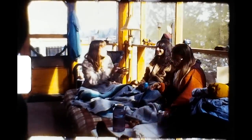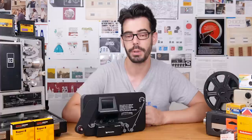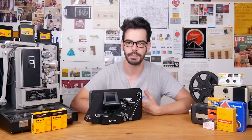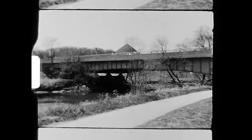It has a resolution of 1440x1080 if you're scanning with the Pro version and has a frame rate of 20 frames per second. Most Super 8 film is shot at a standard frame rate of 18 frames per second and regular 8mm is a standard frame rate of 16 frames per second. But the Wolverine gives you a video file that is 20 frames per second, which is odd. You probably won't notice much of a speed issue on playback, but you can always adjust it later in something like Premiere Pro, DaVinci Resolve, or iMovie.